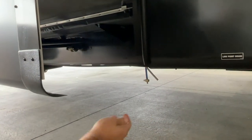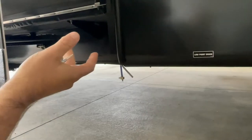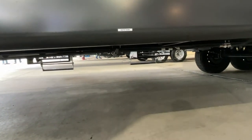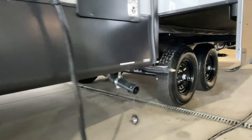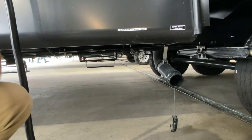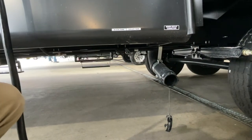As far as the bottom of your unit, on the left-hand side you can see the low-point drain valves. We'll discuss winterizing in a minute, but you'll need to empty that valve first before winterizing. To the right of that is your gray tank — that's your shower water and sink water. Pull that gray valve and it drains out to the right, where there's your sewer hookup. Right beside it, there's a black valve and a gray valve — pull those to drain your galley tank and your black tank. If you have the camper stationary, you can leave those valves open and it'll drain automatically.